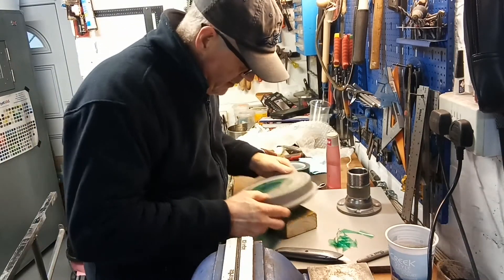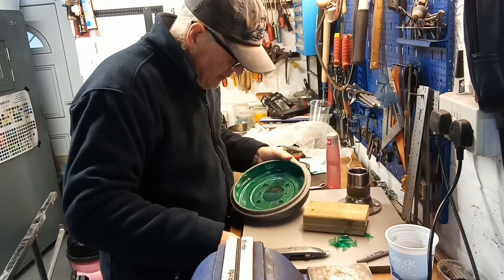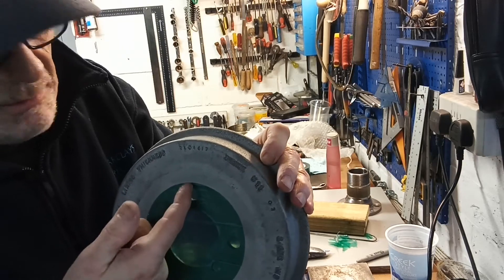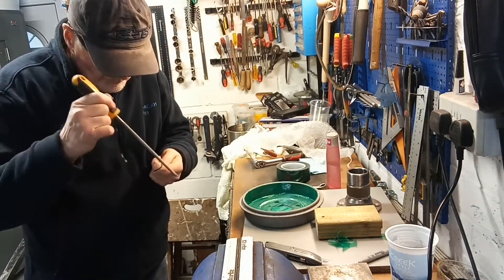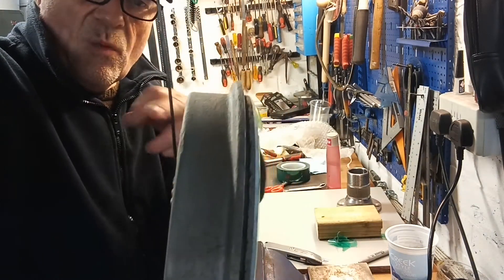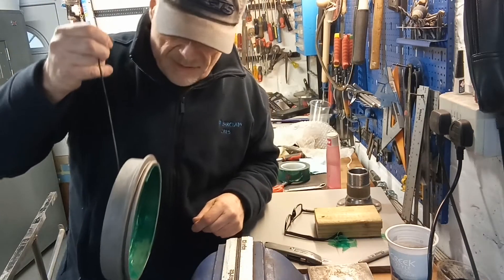Now I've just got to work out a way to hang that. I'm not completely removing the tape - just made a little split in it so I can get the hook through there, get metal to metal contact, and that'll work nicely. There you can see - it's just hanging. See the wire there? It's just hanging away from the surface so the powder can get all around there and coat it. I'll just hang this up and get on with the next one.